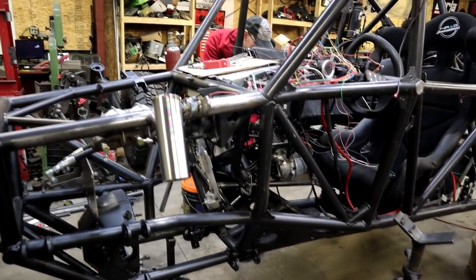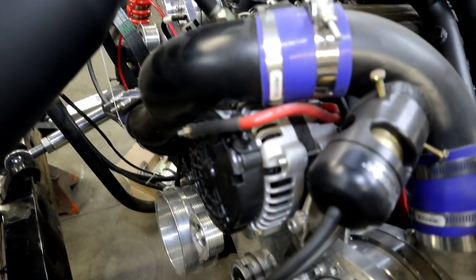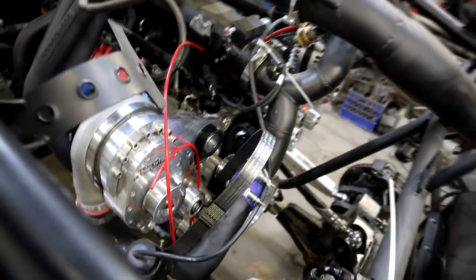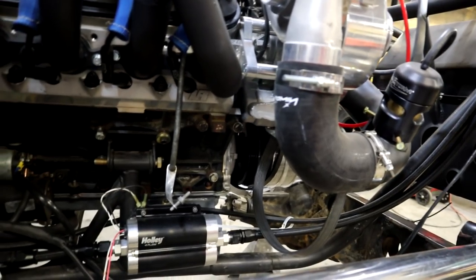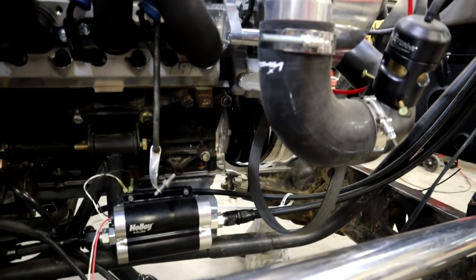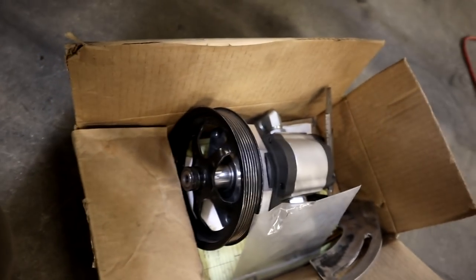For those of you that pay attention, you'll see we had some trickiness with our accessories — the alternator is actually mounted backwards to the engine because there's no room. So we put the steering pump going down here, running it off the rear belt which is typically used for air conditioning. We're using a gear-driven pump — a guy named Scott DeMarco put this kit together and it works really good. We're also using a bunch of Radial Dynamic stuff. We've got to finish our bracket to put the pump there, get it squared up, and measure for all of our hydraulic lines to get those made in the morning.